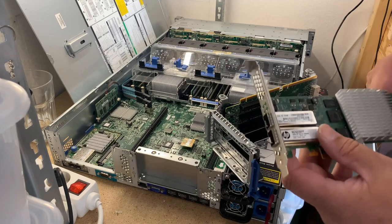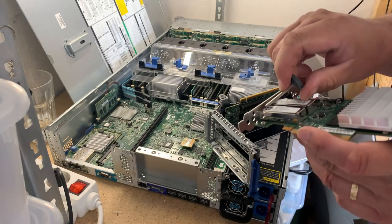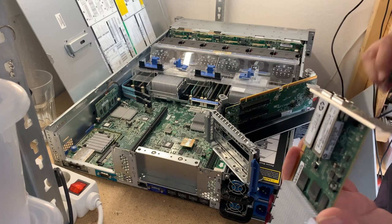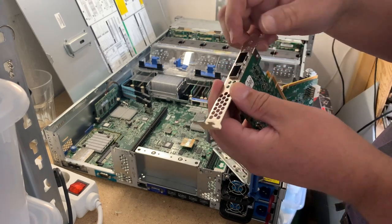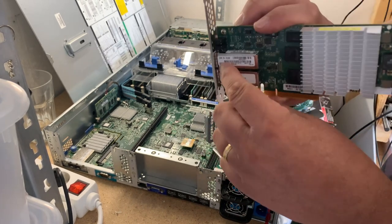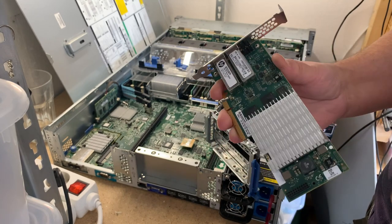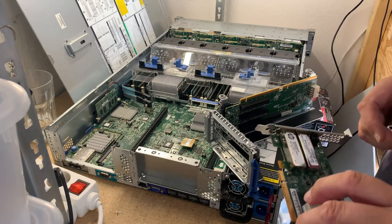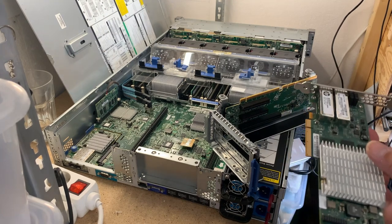So I got it changed. Now I would just like to comment, for those that haven't changed these before, that there's a thin metal formed sheet there, which is cut into shreds. That's the EMC protection, and it's extremely easy to damage that metal when you're putting this on. I actually did it on one of these cards, where I succeeded in crimping up that EMC protection. I don't think it really matters when it's a home gamer deal and you only have one server. Very unlikely to have any technical meaning whatsoever. So you should just take care you don't accidentally crumple it up.